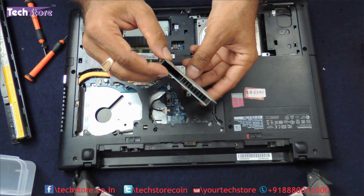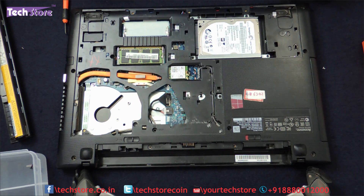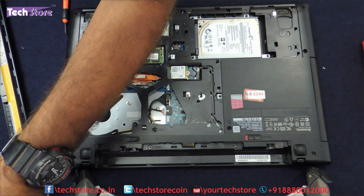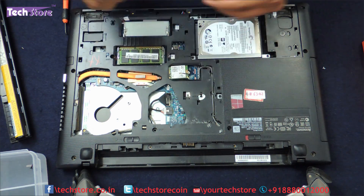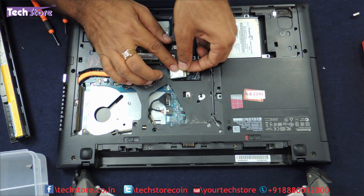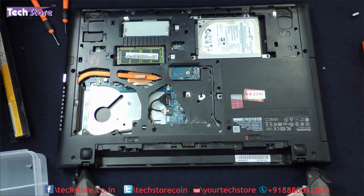Open this CPU fan screw. The processor fan is out — this is the CPU fan. So if it's got clogged and there is a lot of dust inside, you can just remove it and clean it up. Now coming to the wifi chip here, there is this one screw that you have to remove, and then these two connectors. And the wifi chip will come off. This is a similar AC3160 wifi chipset — it's an Intel dual band chip that Lenovo has.